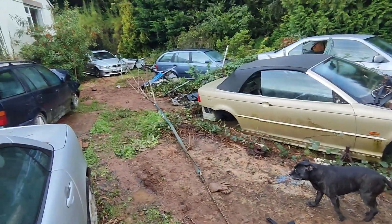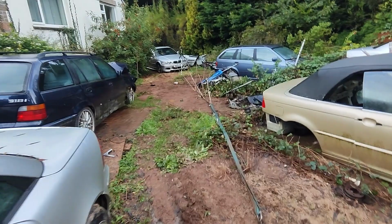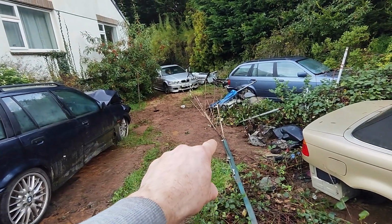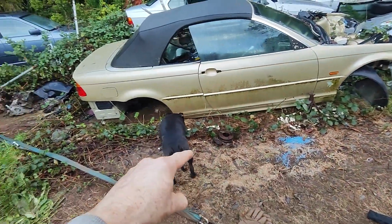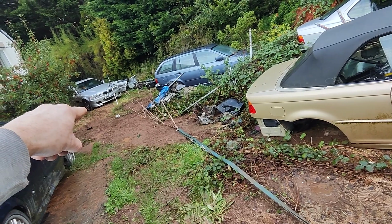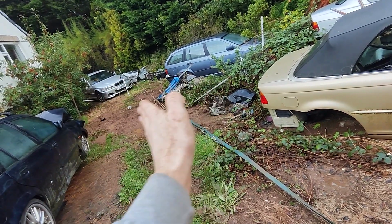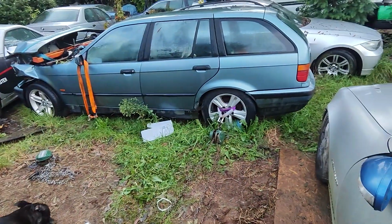So, to be fair, actually, I might just send a couple of those down while I'm out here. And then this one here should stay in line enough that when that wheel comes round and ends up about here, I've got a straight pull back, and then I can probably anchor off the wheel of that silver coupe over there for the other side and do a two-sided pull just to get the thing to come back straight, which will be nice.